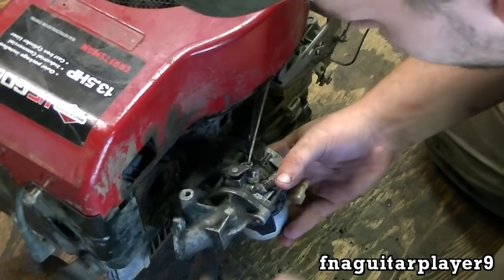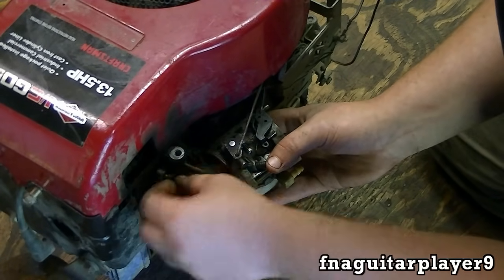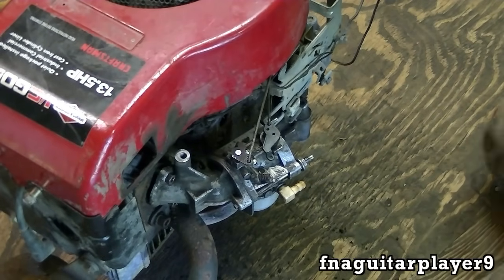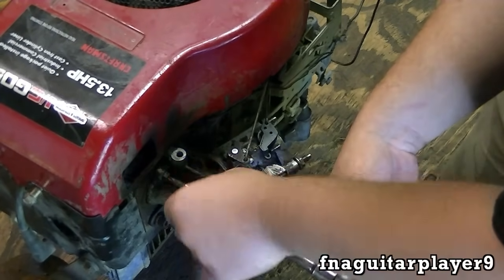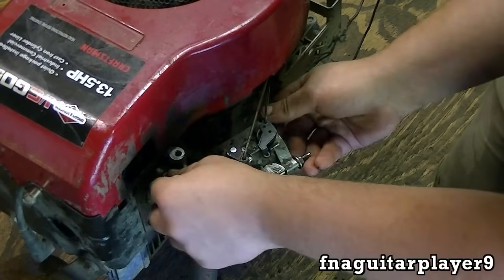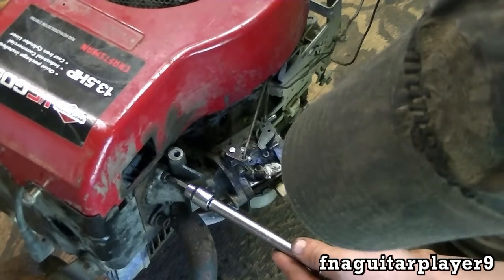The gasket stayed on here — I just switched out to this manifold. Always keep an eye on your gasket to make sure it's still good. Start the screws by hand like this. These are star or Torx drives, though some of them are Phillips. Don't tighten them yet — just get the screw in there to hold it. Make sure they don't cross-thread because you're going into an aluminum block. Get it and tighten it — it doesn't have to be real tight, just fairly snug.